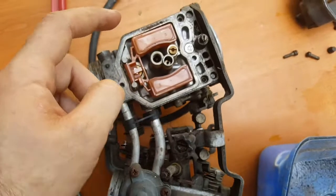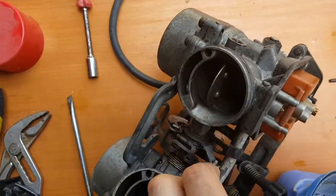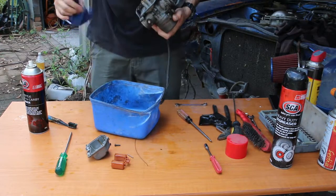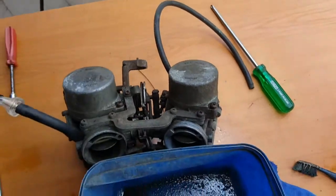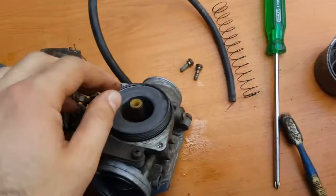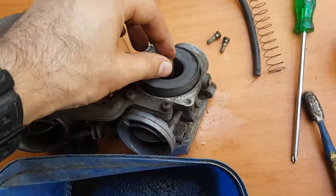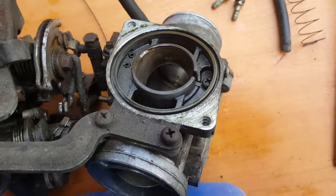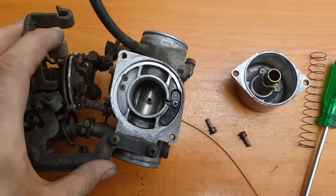I'm going to put the jet back in, then clean up around the edges here, get it all looking neat and tidy, and also spray a bunch of cleaning fluid into both openings, then start the next one. Okay, bowl is back on. Take off the top — clean it with the floats inside. This is your diaphragm that moves up and down based on the air pressure differentials generated by the carburetor, and it allows fuel to come in and out. So clean all that up, same as before — give it all a good clean. Okay, it's all nice and cleaned up now.